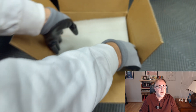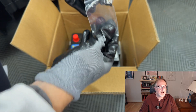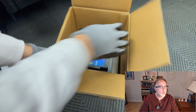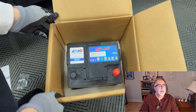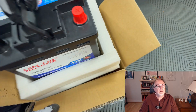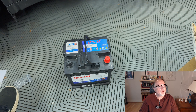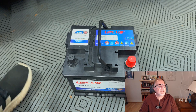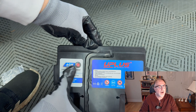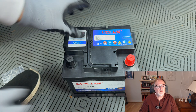There have been issues with the OEM battery, but I think that's mostly due to the transportation of the car from Austria to the US, and also the original software was not very good at maintaining the 12-volt battery. The latest software versions treat it much better, but for most owners the battery has probably been strained in the first six to twelve months. If it's frequently showing 12 volts or less, you should probably replace it. Most of these batteries have three-year warranties, and this one is no different, so I have no problem purchasing the Amazon one to try out.